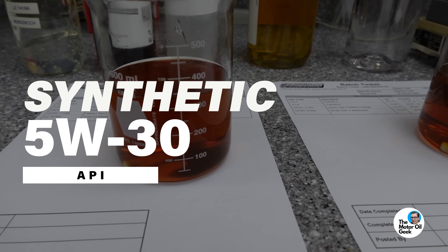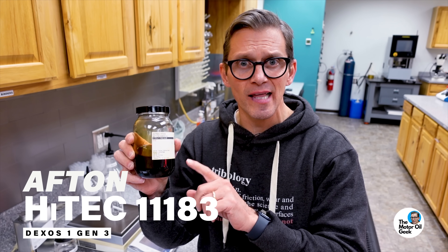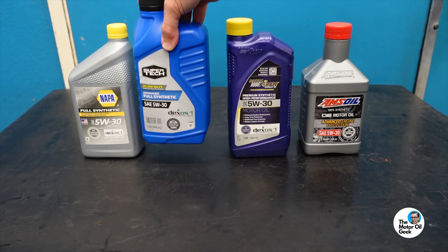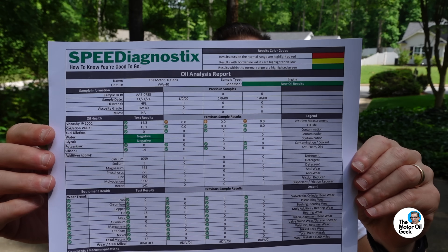And in that previous video we did here at High Performance Lubricants, where we made the motor oil, we made a synthetic 5W30 API licensed oil using the Afton HiTek 111-83 additive package. But we want to go a little bit different — we're going outlaw here. So based on the test results from those 5W30 oils and the used oil analysis from my car, I've got a formula that I'm going to share with you right now to make a 0W40 full synthetic oil for the Wombat.